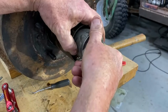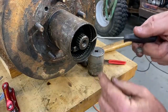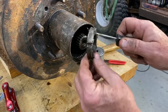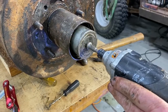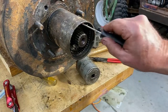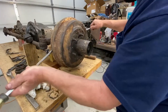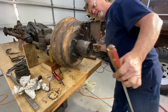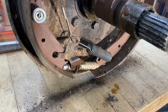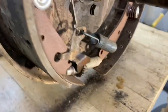It's broken — I should just be able to turn it out by hand. It's being a little stubborn but it's starting to move. It's coming out; I think maybe it's hung up on the brake pads a little bit. If I could have figured out how to adjust that adjuster to loosen those brake drums through that hole, maybe it wouldn't have been so tight, but I got it.